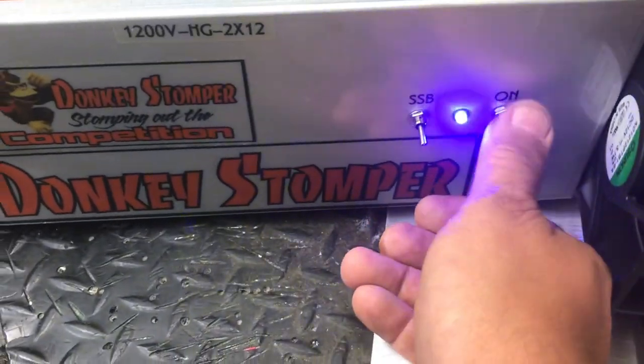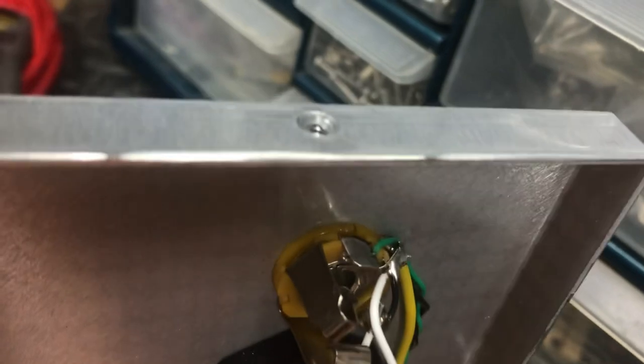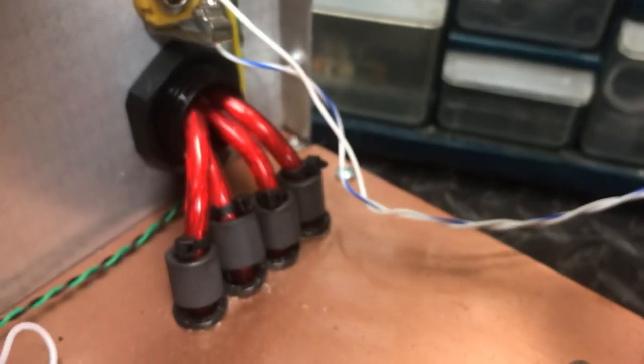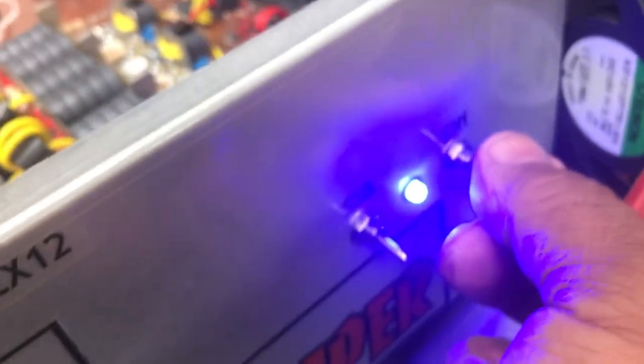What this video is about is remote wires. Right now I've got power. This is a remote jack — a standard remote jack everybody uses. You've got a wire that runs to 12 volts and a wire that runs to the relay. When you turn your mode on, it touches these two pins together right here, and that turns on your amp — that's the purpose of it.